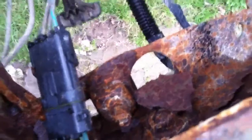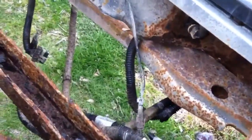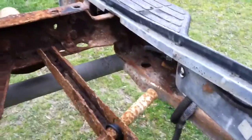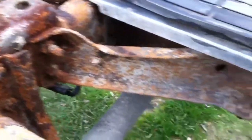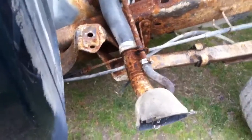It's just a matter of lifting it off. You don't have to remove the bumper to do it — there's a chunk of rust there but the hole is still accessible to get to the bolt, so you don't actually have to remove the bumper. With the light wiring, you just undo the tail lights, pull the wires down and out of the light pockets in the bed, and then there's a bunch of clips across the bottom of the bed. I'll show you that in a couple of seconds. I just kind of wrapped them around the bumper to get them out of the way.